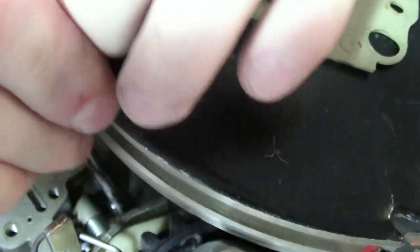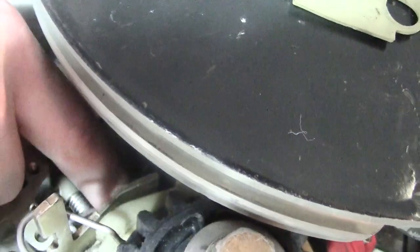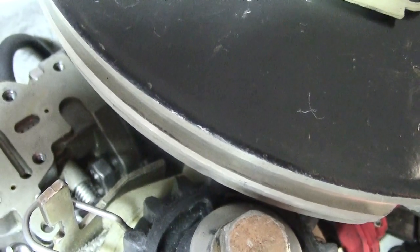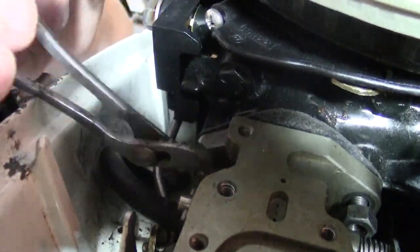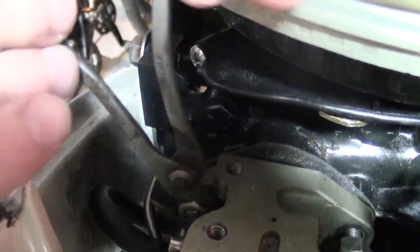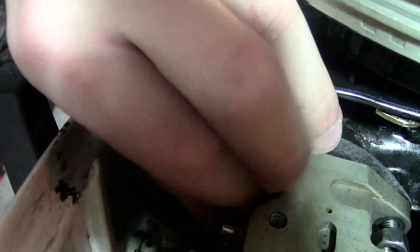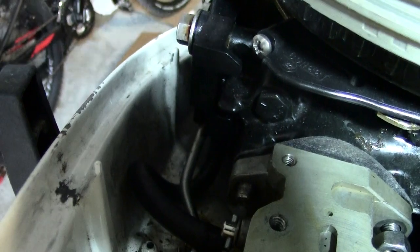Make sure you get a good grip because when you slip over the top of the nut, that's when you damage it. Luckily it wasn't extremely tight so it broke free pretty easily, and once I broke it free I was able to get my fingertip on it and spin it off. I went over to the other side to start removing the other nut — I'm doing this in fast motion because unscrewing that nut took over a minute. Make sure you don't lose these nuts — they are what hold your carburetor to your engine.